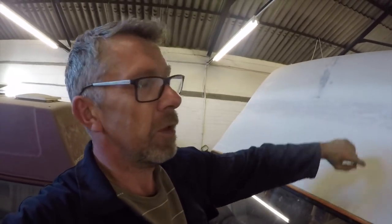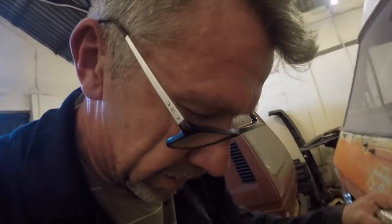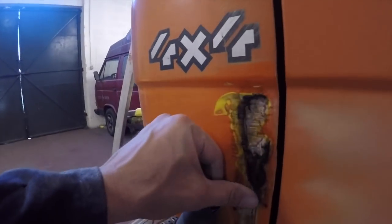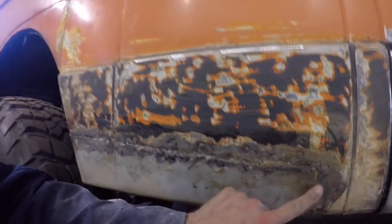The filler is proving to be quite a job on the roof. I've obviously done it before on various different vehicles, but this is the tricky bit because the top of the roof graft is a bit shallower than the lower part. The lower part was proud, which means I've just got to backfill to try and get a nice smooth finish. I'm nearly there, but it's just taking ages to sand. The side looks pretty good, I think — I'm quite happy with that bit. I'm going to take a break and now use a flap disc to just take the top off some of these points down here, where I've used fibre to try and make a base of filler. It's a bit amateur, but let's give it a go and see what happens.